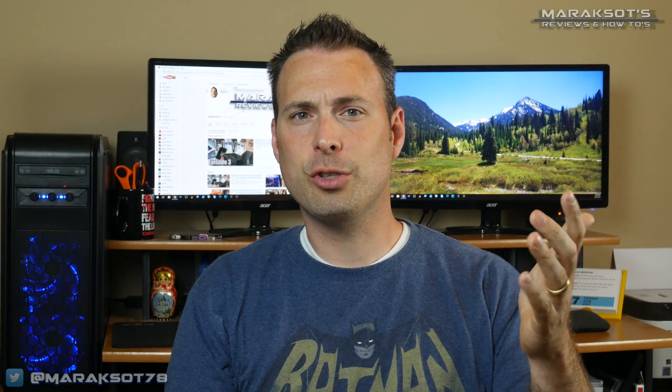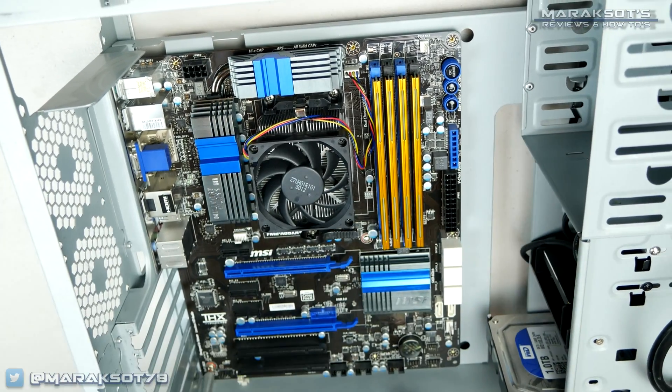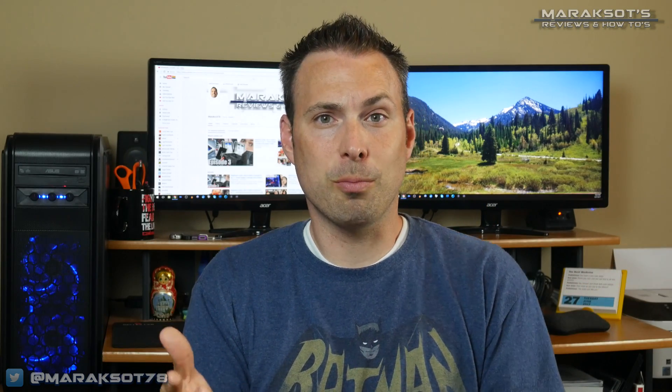At the end of episode 2, I got a little ahead of myself by having you install your motherboard into your case before testing everything and making sure it boots correctly. I personally haven't ever had a DOA CPU or motherboard, knock on wood, but I have heard of it happening on rare occasions. So any good tech geek would recommend that you hook everything up outside of your case first to make sure the system posts before screwing your motherboard into place.